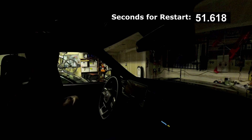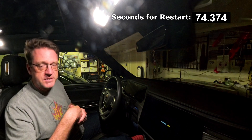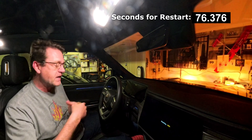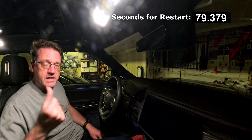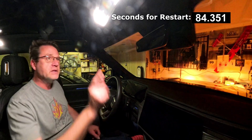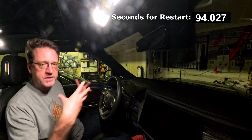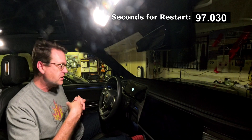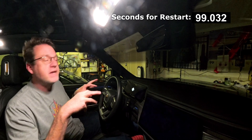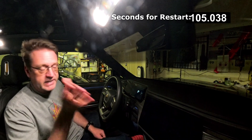If you have some sort of critical problem — we had that happen to us. We had a battery system fault on our big road trip to Texas back a year ago. Once we got the vehicle to Texas, we took it into service and they did some diagnostic work to make sure things were okay. I suspect if you do that twice, essentially you're only preserving the most recent log files and the earlier ones will be lost. My understanding is it takes a long time for some systems to fully restart — BMS or other things that have to do a lot of checking of analog systems — and doing it multiple times in succession could freak it out.